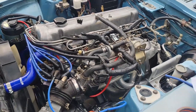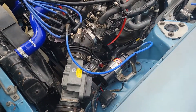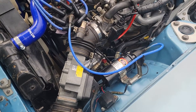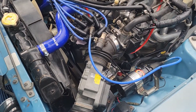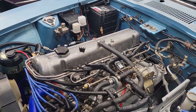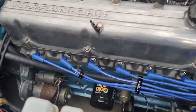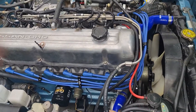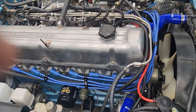So there are the new wires installed. The kit that I got didn't have an ignition coil wire that would work — the wire works, but I don't have the correct end for this Flamethrower Pertronix ignition coil. So we'll keep that one on there for now. In the meantime I'll get an end for it and finish that up, but you can see how much it clears off the top of the valve cover and how all the wires organize on the side. I'm going to clean these up a little bit and put some more wire dividers on them just to keep it nice and organized.